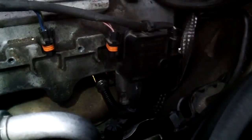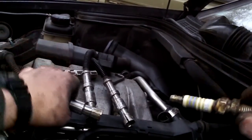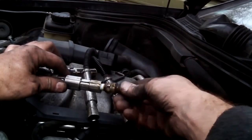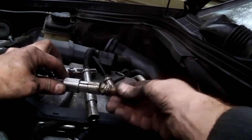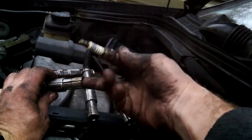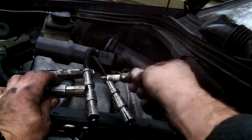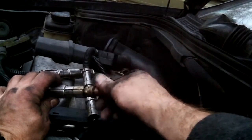Everything's going back together now. The back coil pack is on and the two plug wires on the rear coil are done. These plug wires are a bitch to push in — make sure when you push the plug wire over the plug it snaps on, they have to pop. Even the tiniest bit of grease creates such a good seal that it pushes back on its own. When you blast them full of grease that's what happens but way more extreme, and you end up with plug wires popping off. Lube up the boots but lube them gently with an old plug.